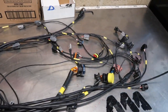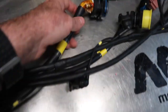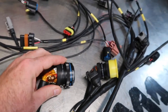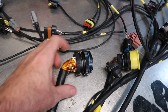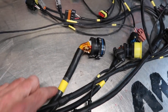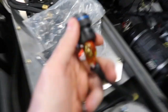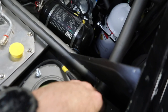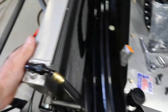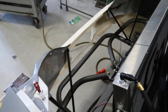We also got some wiring harnesses from Outbreak Autosports. This is the engine harness, which we're going to be putting in shortly. They sent it to us without the boots on it — without the sealing boots — that way we can orient it whichever way it needs to be in the firewall before we seal the boot on, which dictates the direction the harness comes off the connector. Shane has already started installing some of this rear power harness. It's got a bulkhead connector here that goes into this piece of the rear firewall. This is basically power for our fuel pumps, radiator fans, and taillights.